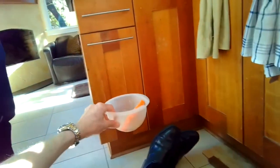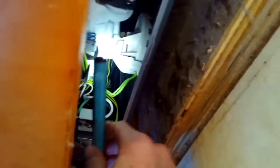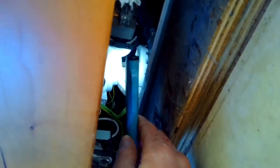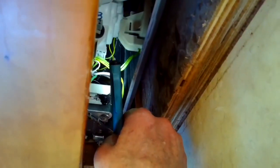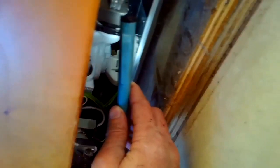Those are the normal sounds. Well, I got this water out. The problem with this dishwasher is that the water kept filling in and wouldn't stop. The fill valve opened up but remained open. So I'm just looking underneath here to see if I can see any leak while it's filling. I don't see a leak, but I notice that the fill just keeps going and going longer than it should. And that points to a faulty fill valve, and that's why it flooded in the first place.